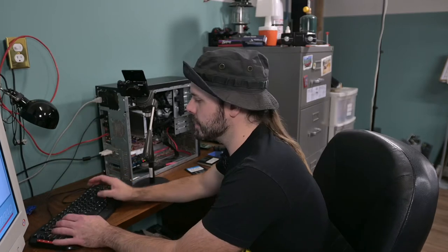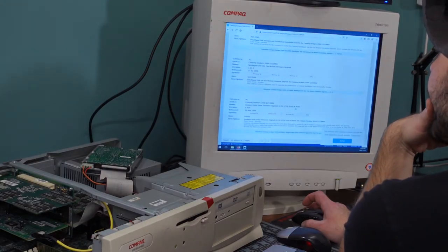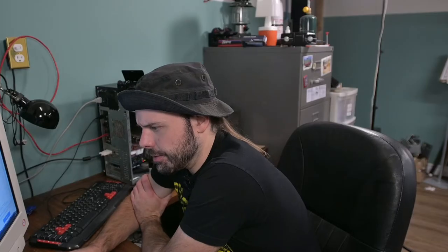I do have accessible on my other computer here. I downloaded something resembling a ROM, SP8435. This program can't be run in DOS mode. Huh? Oh, hard drive firmware upgrade to fix 1720 error at POST. The upgrade will not be applied if the hard drive is not on the list or already has firmware 043B.